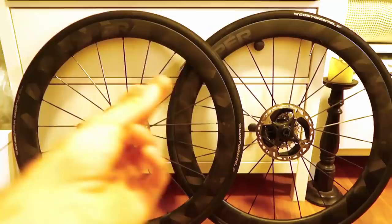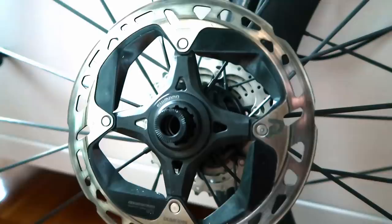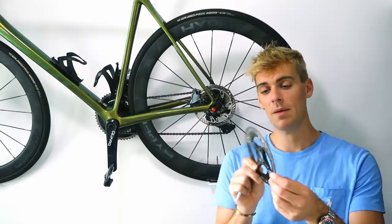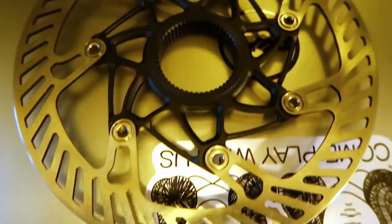I've had two sets of Shimano rotors - one was a Dura-Ace front and rear, then I tried XTR front and rear - and both of them I just can't get to last beyond about six months. To replace the set costs about a hundred quid, so that's £200 a year just replacing these. The Campi rotors do fit on Ultegra calipers - they're 160mm, same kind of thickness, so they fit straight on.